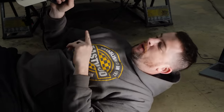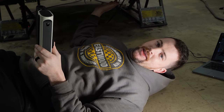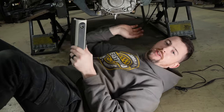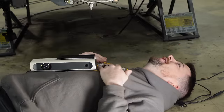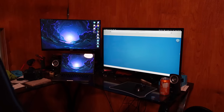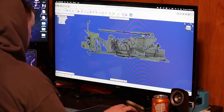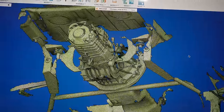I'm 3D scanning the underside of the car so we can take some time and come up with a couple of different designs to tweak. Because if I did cardboard right here, it's going to be a pain — just lay down, cut cardboard, push it back up again. We have the technology, might as well use it. I've got the data I need. We've got the shifter, the diff here is the lowest point which I also need to work around, as well as these mounting plates where I'm going to mount the plate I'm making, and that tube across the front.